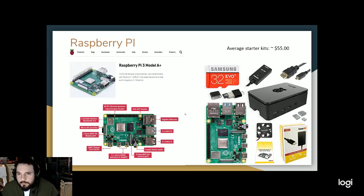So first, this is built on the Raspberry Pi platform. So here's my model, a Raspberry Pi 3A, which is a fairly powerful little computer for $30, $35 selling it by itself. This down here is a little bit better model, the Raspberry Pi 4. The big difference is you have dual band wireless, so you can use the 2.4 gigahertz, 5 gigahertz. It's a little bit faster processor, gigabit internet, and 3.0 USB, which is really, when you're talking about the way you probably want to run storage, running it through USB to external SSDs or thumb drives, so that 3.0 USB would definitely make the bigger difference.